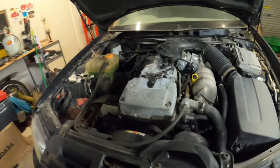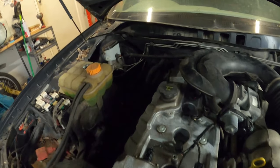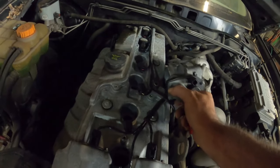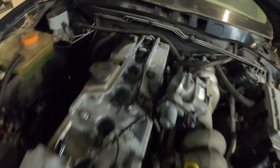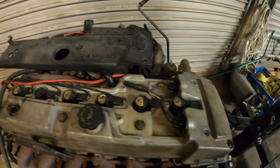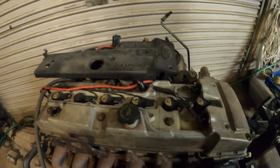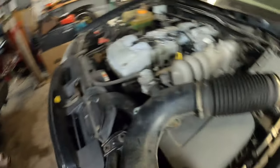Just been having a quick look over this thing and it's not as bad as what you might think. It's had a fair bit of stuff robbed out of it, but I found the throttle body. There's a gasket that's probably fallen in. The only thing that's really missing to run is some coil packs, which I do have a bunch of coil packs on this BA XR6 Barra, so I can rob some coil packs out of that. That's easy. What I do like about this car - plugs are still in it, so there's a pretty good chance that the bores are not full of water and all rusty and horrible.